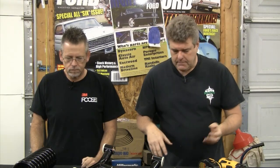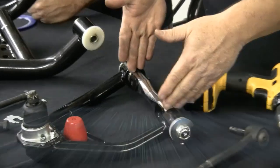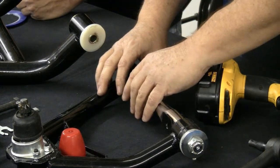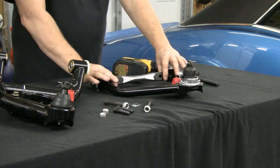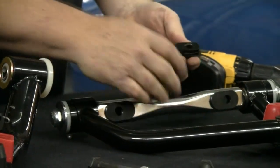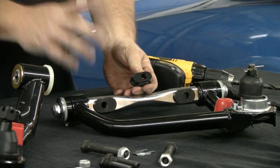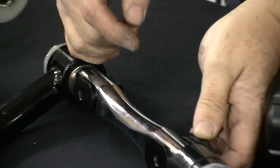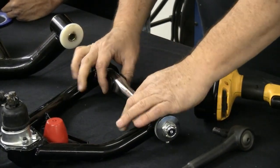You're not going to do your own alignment — we recommend you take it to a shop. Now a couple of detaily items: when we first started with these control arms, the bolts would not correctly pass through. What we figured out is when they paint them, the paint inside the hole builds up enough that it won't allow the bolts to pass through. So I took a drill motor, passed it through, and it's just fine. Now these are cammed — the bolt hole is actually offset to one side. On the Camaro, you may need to move one side to get it to bolt in correctly.